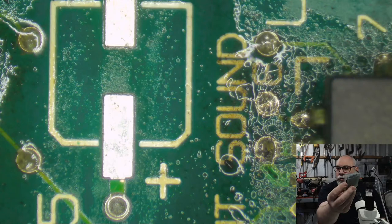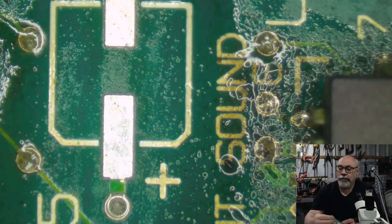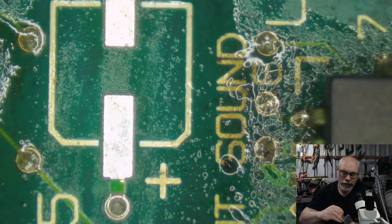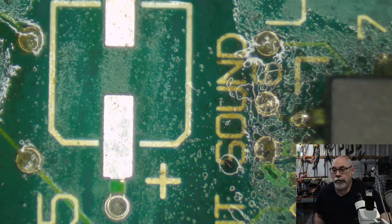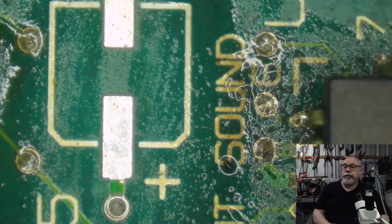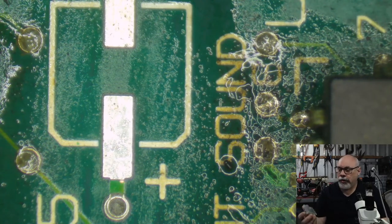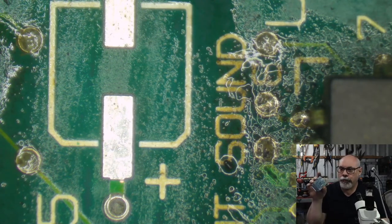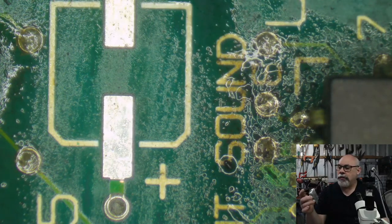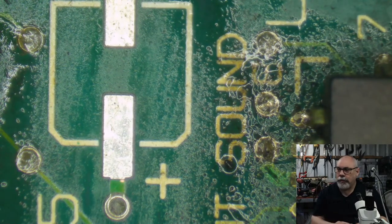And once you have them all formatted and everything, you can then copy stuff onto it. This here has a 16 gigabyte SD card in it. Now on those old Macs, they won't recognize anything larger than a two gigabyte partition. But so that I don't end up with 50 million hard drives coming up on the screen, I usually format just half of it. So I do 4 two gigabyte partitions, essentially 8 gigabytes. And on all those old Macs, that is so much space.